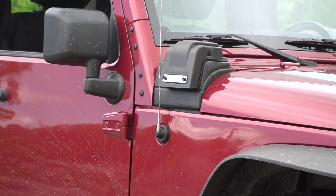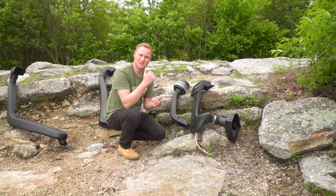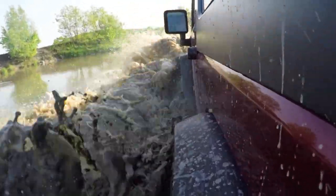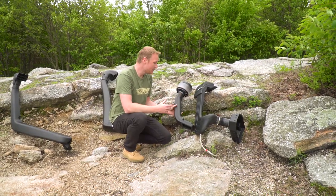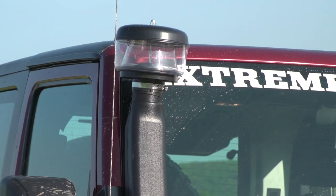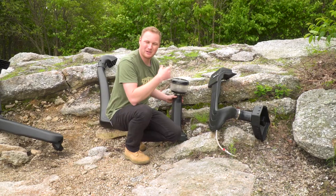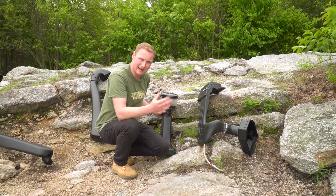The other big benefit to this snorkel is that it is a modular snorkel. What we have on the Jeep is the low mount — that's going to be just above the cowl. It's going to be a great cold air intake, and if you're just doing some really short crossings or you're worried about the entrance into a puddle creating a little bit of a wave and you just want a little bit of protection, you can run the low mount. If you plan on going through some deeper stuff, you can pop the high mount into place — this attaches very easily and moves that air intake all the way up to the top of the windshield frame. And this also has that pre-filter, which is going to give you an additional filter before the air even gets to the main air filter.